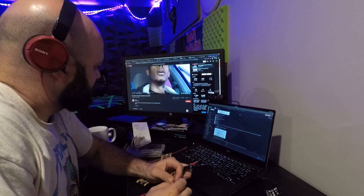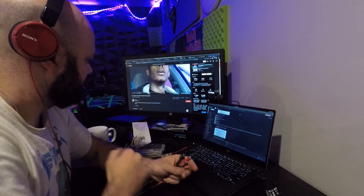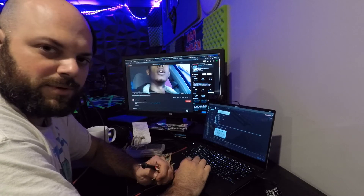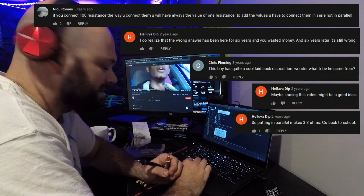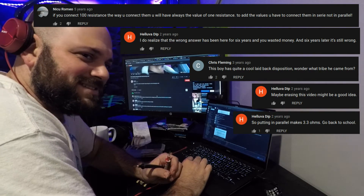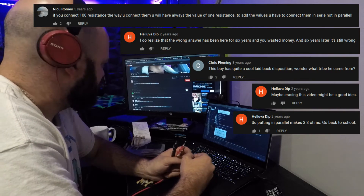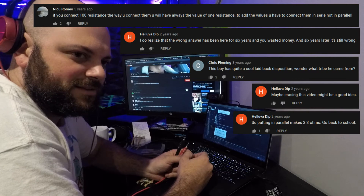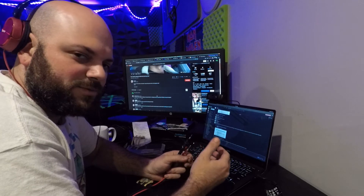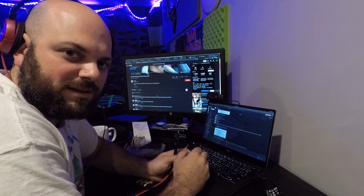The video that keyed me into the resistor trick to get the airbag light off was posted a while back from YouTube user 89inpo3. You gotta read through these comments — I'm gonna post this video in the description. Some of these people are just nasty to this dude. The heated debate basically came down to this: he describes getting three 10-ohm resistors, and if you attach the three of them together, it'll reduce the resistance to about 3.7 to 3.9 ohms.